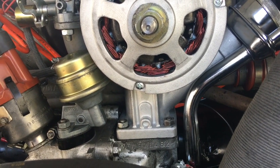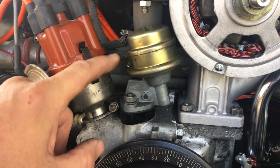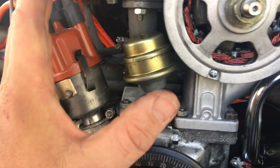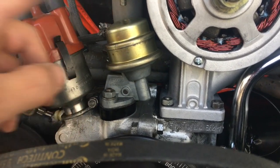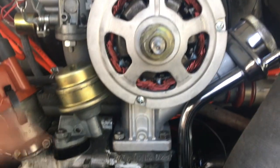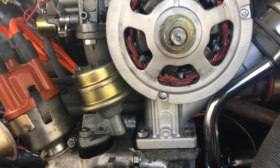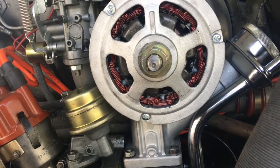Remember, when you change out your fuel pump going from generator to alternator style, you also have to replace the rod. The rod is shorter because the alternator is tilted, and the little pushrod that drives the pump sits a bit deeper in the block. So you've got to change that out. I had gaskets and stuff laying around, but you might have to buy all of this and do some fitting and fiddling.